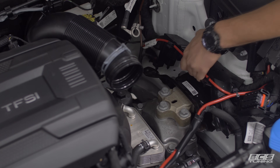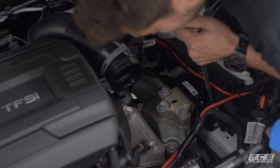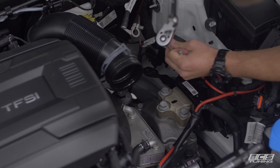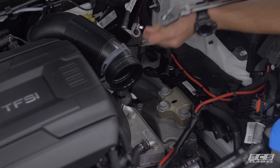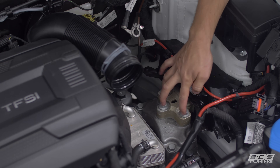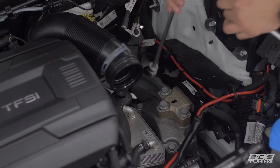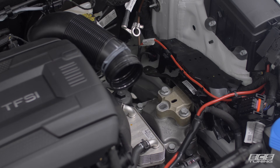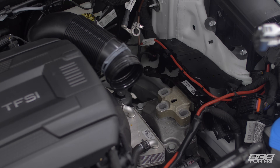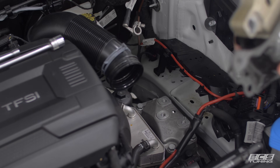There are four bolts under the wire channel — they are 16s. I've got a long extension on a 3/8 ratchet with a swivel 16. Try your best to make sure you don't move the engine from its original location when you jack it up — just assume the weight of it, keeping it in its original orientation. Now that we have the body side bolts out, we just need to remove the trans side bolts. There are three of them and they're 18s. And there you have your transmission mount — let's replace it.